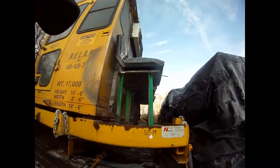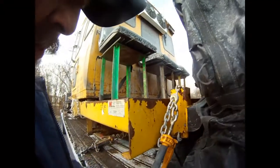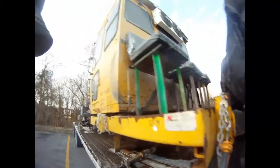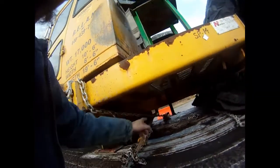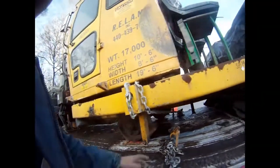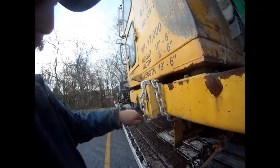So let's look at the chains. Very wild, but I pulled it and dropped it down in here so I could have enough room to go across with a single chain. I mean, it's tight as a drum, but there's my chain binder, loose chain again. And then I did a cross in the front, and you can see that's good and tight there, but I needed to stabilize that. I had to come up, down, and up through for this situation, and focus on that a little bit, down and up through.